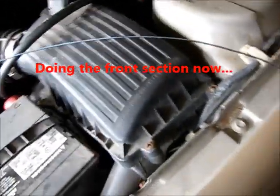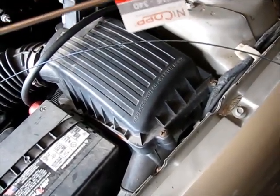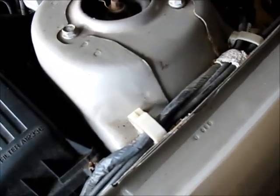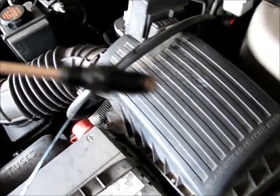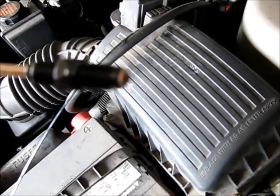For the front part, we're routing around the front. We've picked up some flexible nickel-copper line — a copper-nickel-steel alloy — and it's very easy to bend, which you need here because we're going to be going down through there. We've also got a fish tape, basically for electrical work. Make sure your battery is disconnected when you start poking around down there. We're going to get this fish tape through an opening, work it down to the bottom, then tape the replacement line onto it. Make sure you definitely tape off the ends and tape the fitting right to the end, then tape over the opening, because you're going to be feeding this line through and you don't want to mar it.